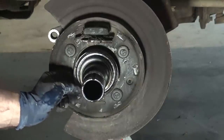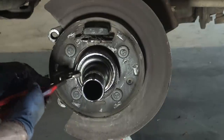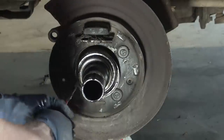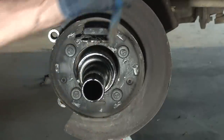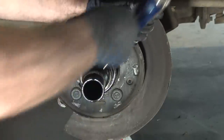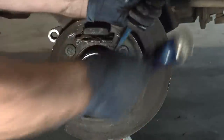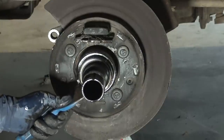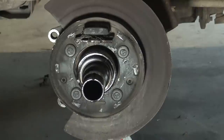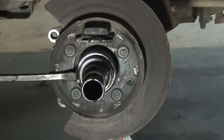This is the inner part of the seal. It's kind of like a wear ring. You can get these off in several different ways. You can cut them off, you can bend them off. So this chisel's way overkill, but take a chisel, put it right on top of there. We're here to the other side. I usually loosen it up enough where it'll pop off.